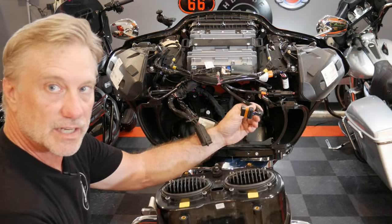I just zip tied this — I'll obviously clip the zip tie once I get this all buttoned up. We've got the headlight assembly re-assembled in here with the four screws. These little side covers have got those screwed back in. I've got everything pretty much buttoned up now. It's basically the reverse of the process when we uninstalled everything. The only thing to be careful of is that you do have some excess cable from the new WIM module — just make sure you've got it stuffed up underneath where the WIM module is, so it's out of the way and doesn't get pinched by the headlight assembly.